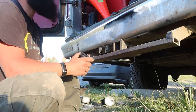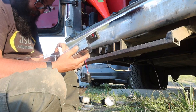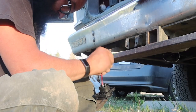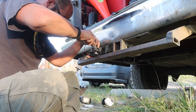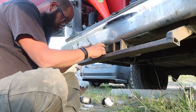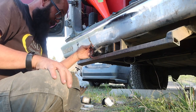Which one of these is trailer? Give me directions — not just abbreviations. Let me look up the diagram online. Seven-pin connector. What's the center pin? Yellow — reverse lights. The center is yellow. I don't have a hookup for that; I'd probably have to run that wire. I'll deal with that one later, because I don't even have a wire run for it. I'll probably just have to unplug it to back up the trailer, otherwise it'll think it's in reverse depending on the trailer.